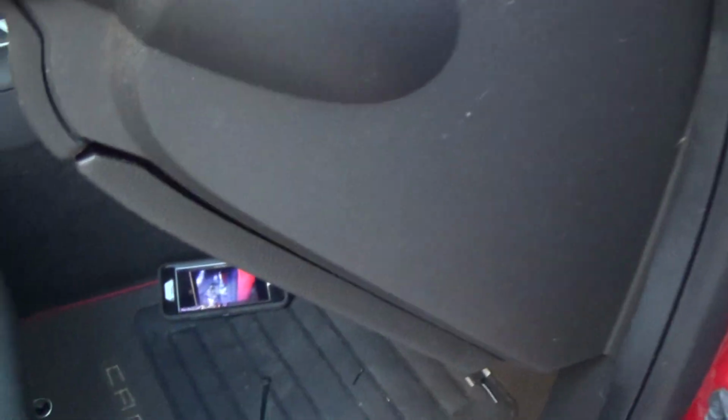I haven't done it yet, but I've changed my mind, and I'm going to add a fuse link. The reason is that there is no fuse for the dome light, and I am not a GM expert, and the dome light goes to a computer module, and I just don't want to take a chance. For just the door sills, it's about 3/4 of an amp. So the LED lights take very, very little.